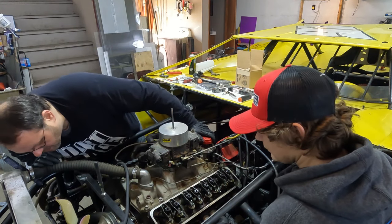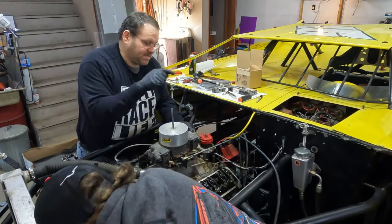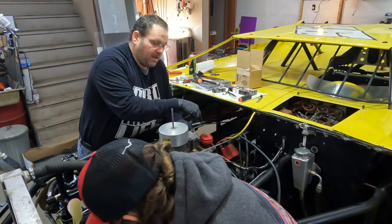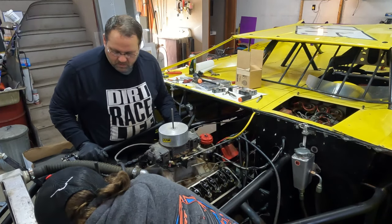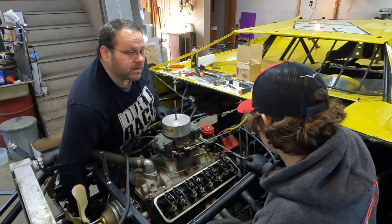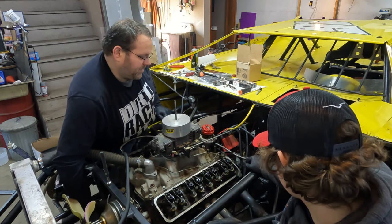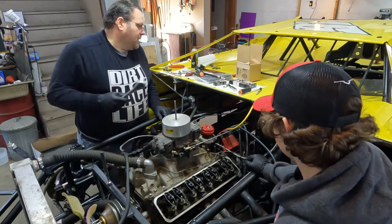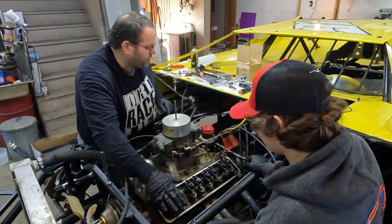So what are we going to need? Let's get a five-eighths wrench here. It may take us a second to first get on it, but then as we're doing it we're just going to be moving up one-eighth at a time, so it's really not hard at all. Tell me when I'm on number one. All right, there. It ain't got to be perfect — anywhere close, that cylinder is just getting close to it. All right, so we're on number one, we'll start right here.